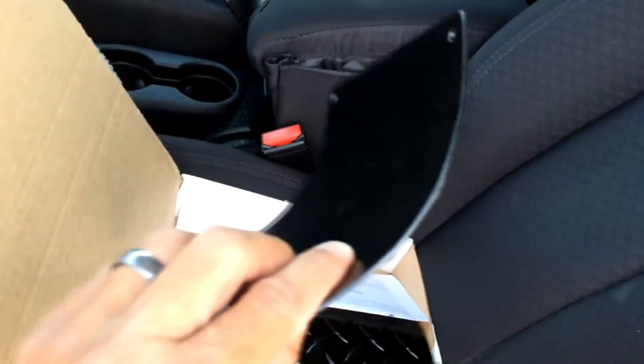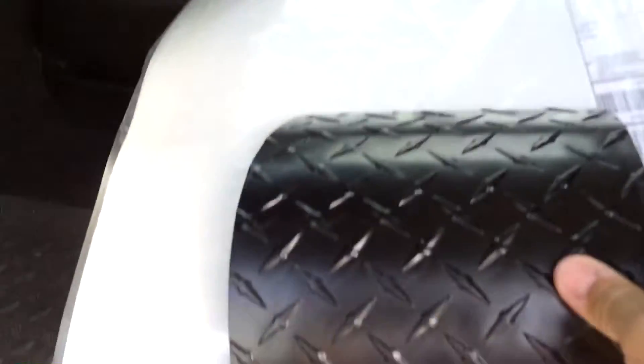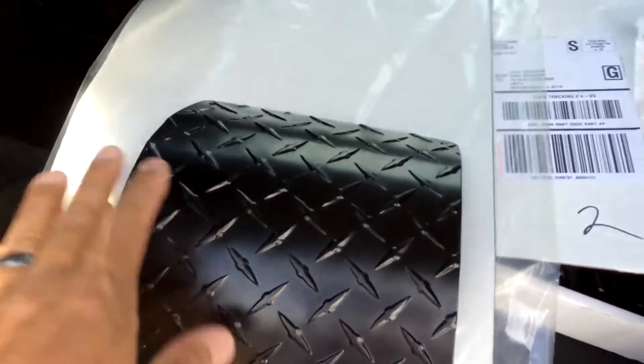I had to bend it myself. Now, you're going to put these metal cowl covers on your Jeep, and what's going to happen is there are going to be gaps — sand, dirt, rain, all the elements are going to get underneath and rust your Jeep very quickly. So I thought about it and said, how can I fix that problem? This will do it — it's a 12 by 24 sheet of neoprene rubber. The white side is an adhesive peel-off backing, and I'm going to trace a piece of this underneath, peel off the backing, stick it on there as a layer of insulation and protection. That should work very nicely.